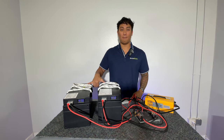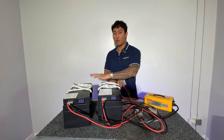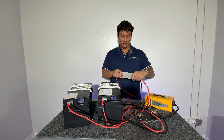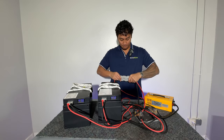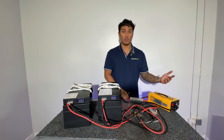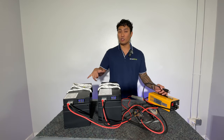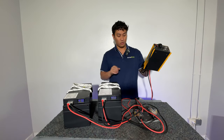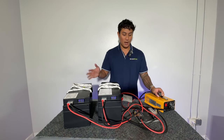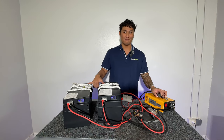After you've hooked up both batteries to your bus bar, you can now use this charger to charge both batteries at the same time. We have the big Anderson cable connector, so you just connect it and plug in your charger to charge both batteries simultaneously. You don't have to worry about overcharging because we already have a built-in BMS, so you can leave it on overnight. You can attach your charger directly to your golf cart and leave it charging overnight without worrying about overcharging. That pretty much wraps up our tutorial video on how to install your two Badgers to your bus bar. Thank you.